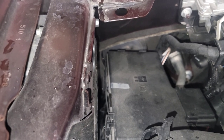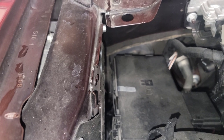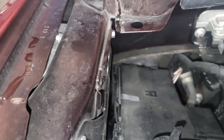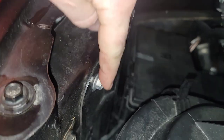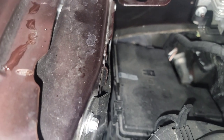Ideally, what Ford should come up with for these problems is they need to make like a tray or a trough that you can actually adapt to this area right here — something that will slip over this and have a channel that comes down to this bolt and bolts in, so that water could run along it and drip out here versus right up there by that fuse box, causing water intrusion issues.